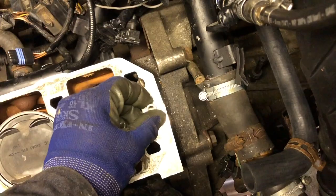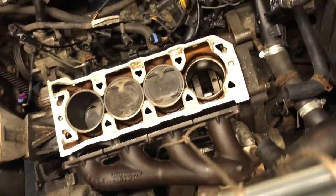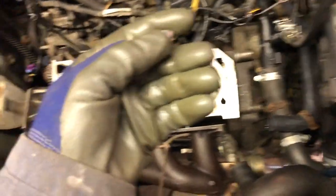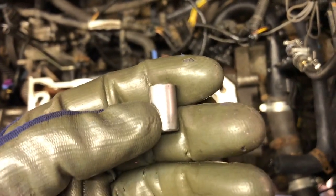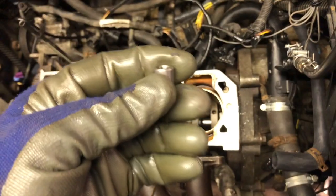Another do: make sure you use these steel dowels. Some engines have plastic ones. There are two of them — they go into the holes in the block and also into corresponding holes in the head. If your head has been skimmed a lot and you insist on using it, it's also worth checking the depth of the hole versus the height of the dowel sticking out. I've heard stories about the dowel actually stopping the head being tightened down sufficiently.